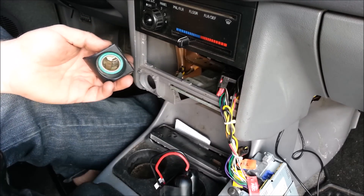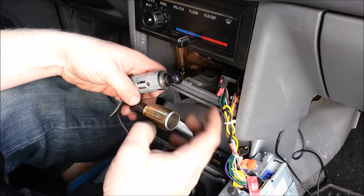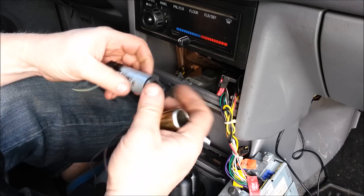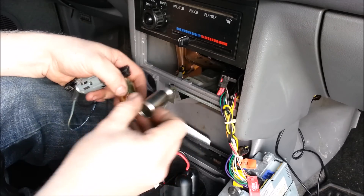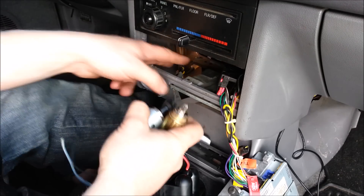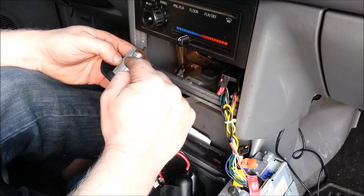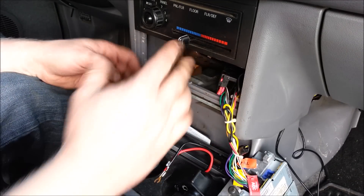You can buy these, but I also like to use these which are just like the Ford ones — both of these are Ford items you get from the wrecking yard. The negative touches the outside and the positive is always in the middle. These are great for adding to different vehicles because all you have to do is drill a hole with a hole saw, slide this through, it has a lip on the back, and screw it in. On this one the wires are tucked back, so I'm actually going to solder connections to this which connect to that — it's much easier to get to.